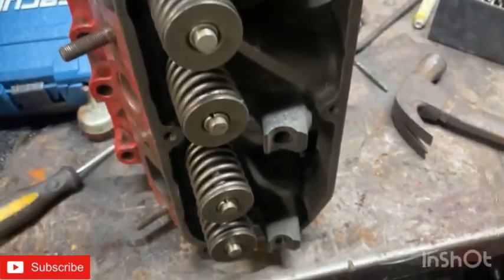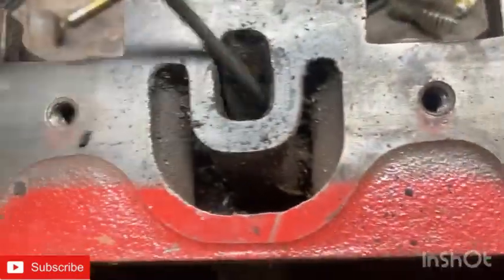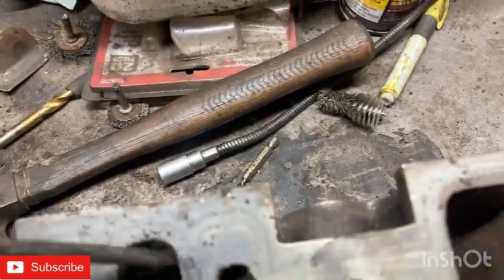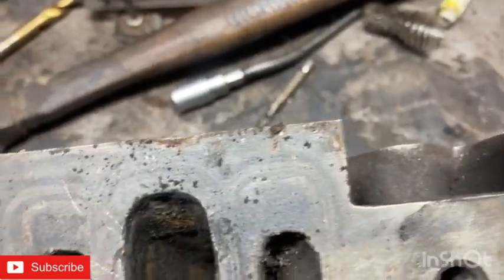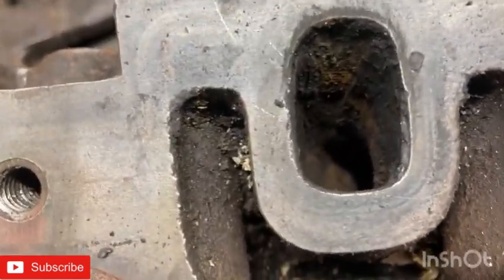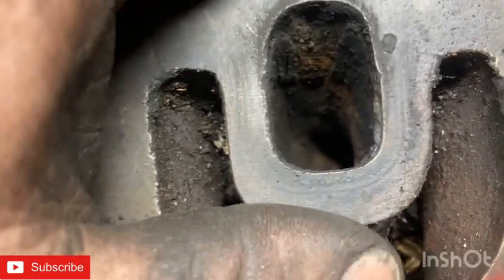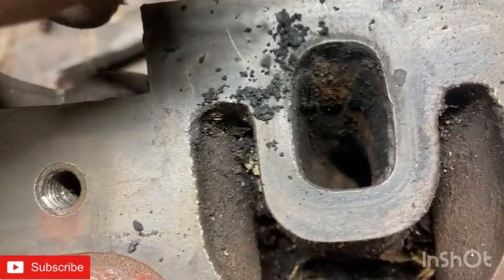The head's assembled and clean, but I still need to repaint it. I also wanted to show you this thing right here — it's your exhaust crossover. Look how much black carbon came out of that other head, and now look how much is coming out of this head — this thing was plugged full. On a performance car these get capped over with little plugs or welded up. I'll run a drill through here to clean it up so that plug fits nice.